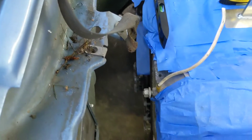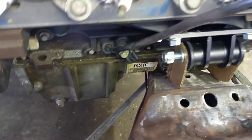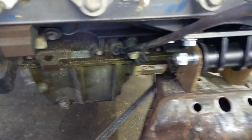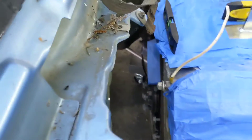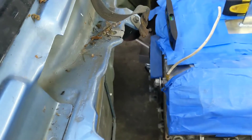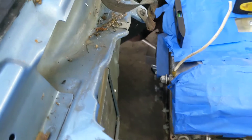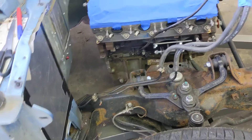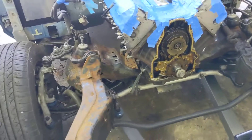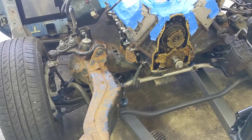From the firewall to the back of the block, we've got a fair amount of space there too. We could have probably gone back further, but that would have required creating some sort of extension plate off the back of the crossmember to get the engine moved back further. Even if we slid these all the way back, we'd still have a good two and a half to three inches there maybe. But this way it's going to give us good access to the bell housing bolts, and easy access to stuff is just as important on a car like this — it's probably going to come out once or twice a month. So we're going to mark the spot where the mounts are going to be welded on and weld the mounts onto the crossmember.